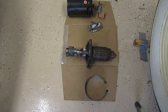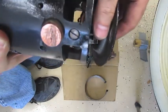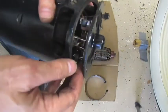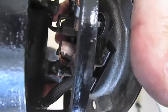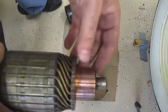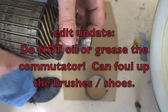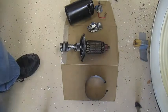Those are most of the parts of a Model A starter motor at a high level. When you take it apart to paint, keep in mind the brushes — sometimes called shoes — each have a spring to hold them against the commutator. When reassembling, you'll need a piece of wire to lift the spring and seat each shoe. There are four copper shoes that sit against the commutator. Make sure the surface is clean and shiny — I put a little battery terminal grease on there to keep it from corroding.